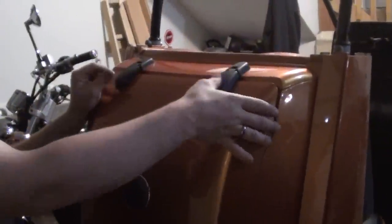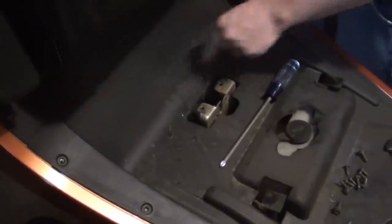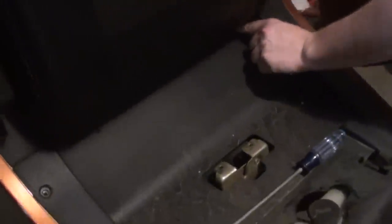I removed the four screws that hold the door to the back arm — just regular phillips head screws. I've got to pull out all this lining and pull the back of the back seat off so that I can get to the bolts to start disassembling this back piece, so I can get this off because there's a row of screws under here. I'm going to have to take these four screws in the bottom out, and along the edges there are multiple screws that have to be taken out, and then all this has to be un-velcroed and pulled out.